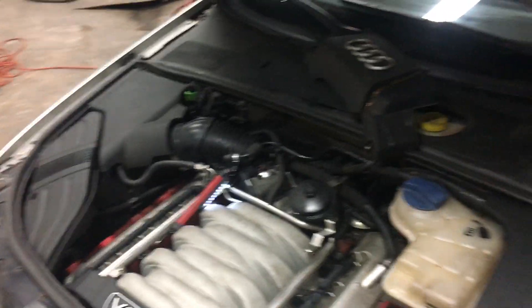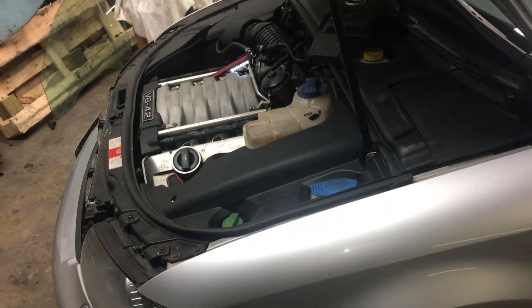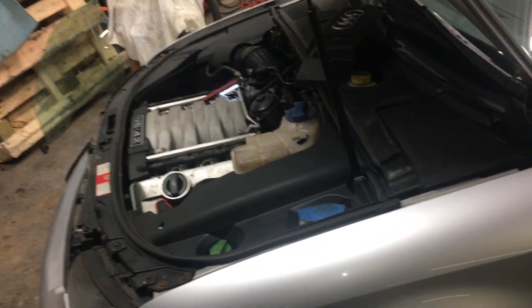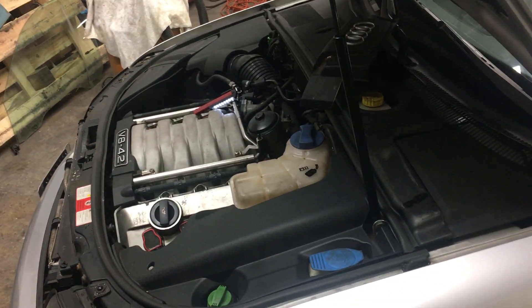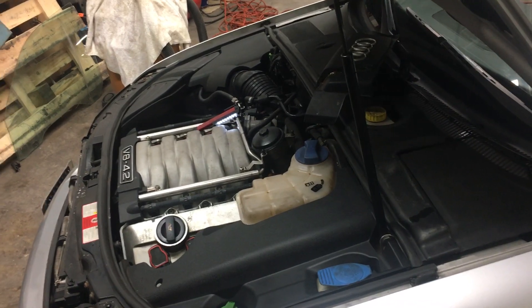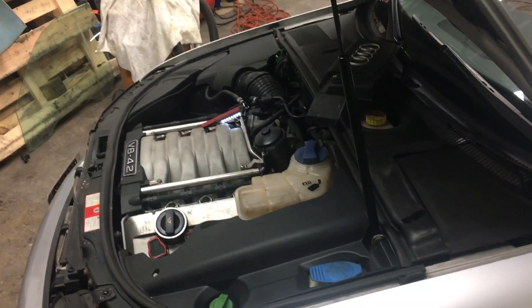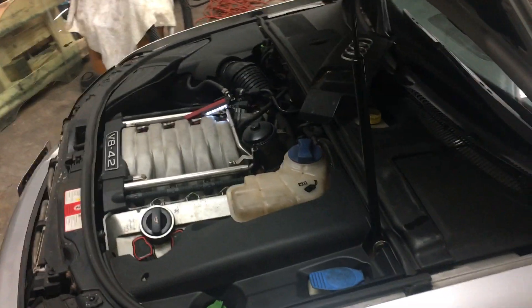Some things you want to check: obviously you want to disconnect your secondary air pump. Make sure that your secondary air pump, when you give it 12 volt from the battery to the plus and minus, that it's spitting out a decent amount of air. If you spin it once you take it off and it's got a lot of water in it, when you activate it, don't activate it longer than 10 seconds — 5 seconds in short spurts. You'll kind of burn it out if you hold it too long.